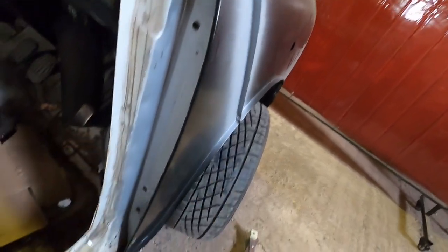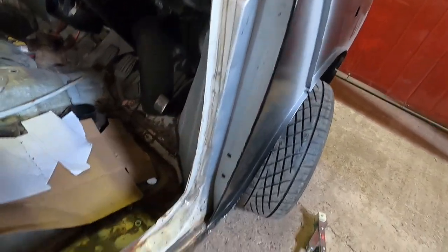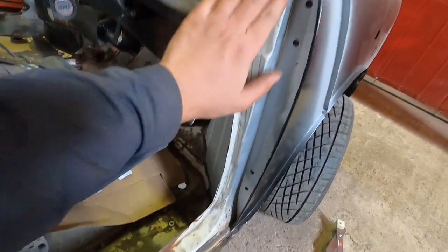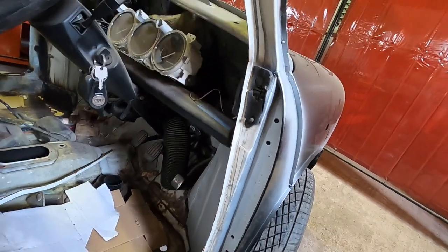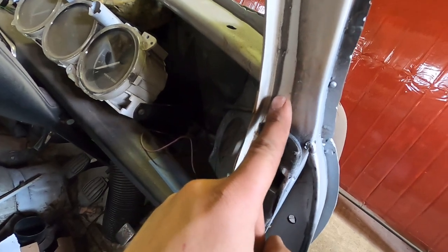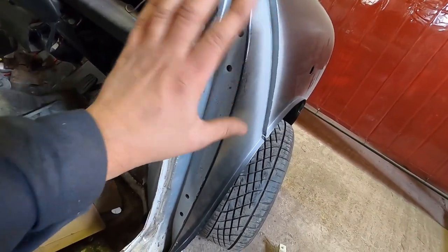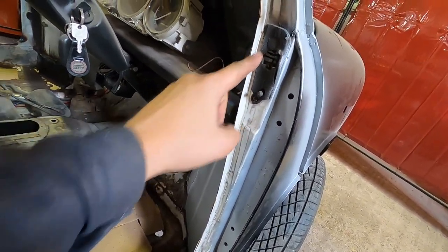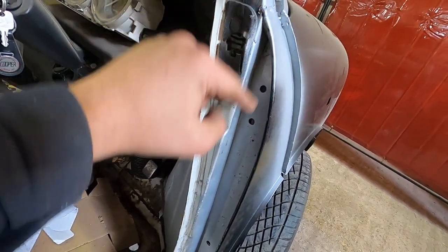And there we have it — that is now fully folded all the way down. It'll also add a hell of a lot more strength into this area of the car because you've folded around your doorpost. The doorstep comes up along here and up there — we don't need any of this, this is all really good. It normally is really good on Minis to be fair. It's normally when these go, it's due to poor window sills — this car has been maintained, it's had good window sills. You can see they're so good it's actually left really shiny paint under there. We've already dealt with all this area, and we've only had to repair this on the Budget Clubman and on the MPI over there — it's just rot in that corner, and what we did is used a piece of another panel and put it in there.